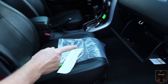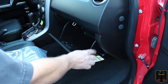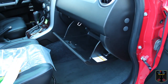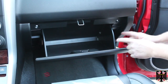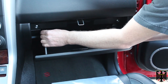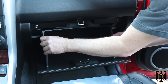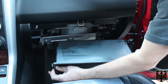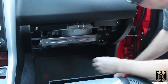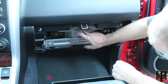I'm going to take this screw out and take this door off. I'll pull the mechanism out of the way and pop the door off. I've taken the glove box door dampener loose, and on this one all you do is gently pull in the sides — not too far — and it allows you to take the whole door off. It has these little side mechanisms and a little hinge here, and we're going to gain access in here for the filter.